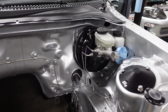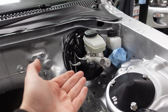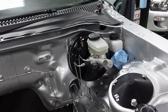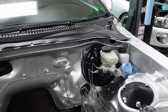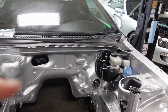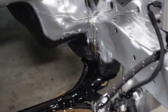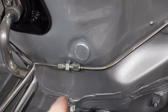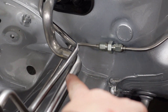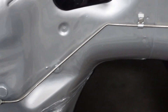This build isn't even close to what those guys do, but I wanted to do something kind of like that. This is going to be a driver and we don't have the weather they do, so stuff's still going to get dirty. I don't want to take those lines off because I still have fluid in them — I capped them off. I'll put a bucket under there when I take those off so it doesn't rush out but just drips. I'll put a rag, tighten it up, hit it with brake cleaner. Also need to put one more clamp right there for three total.